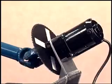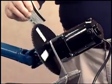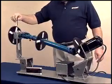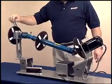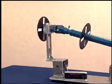As the output of the U-joint changes speeds, so does the drive shaft, even though the output yoke itself is maintaining a constant speed. When the operating angles on each end of the drive shaft are not equal, the non-uniform velocity is transferred to the input yoke of the driven member.